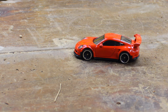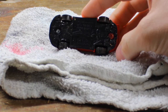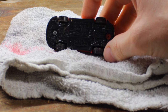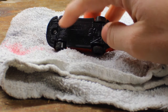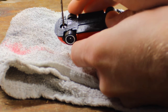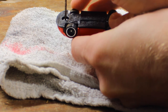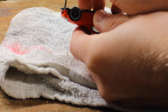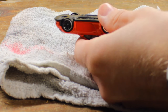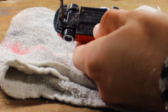Now we're going to open the car up. If you want to protect the paint of your car in this process, I suggest just getting a rag and laying it face down on the rag. Now underneath the car there are two rivets — one here and one there. Some cars just have one, but most cars have two. I use two different drill bits to drill out these rivets. I use a smaller one to create a pilot hole for the bigger drill bit, and I drill just enough down into this rivet that it's past the plastic part of the car.